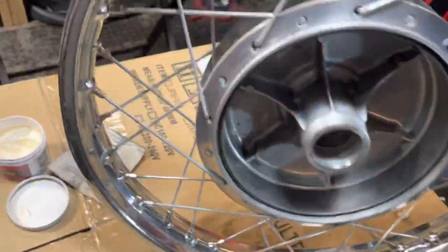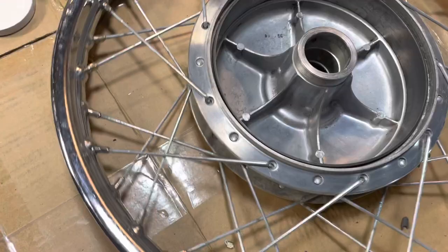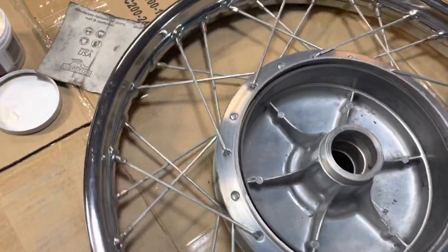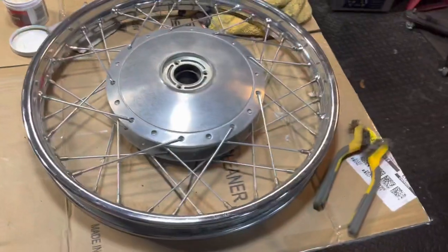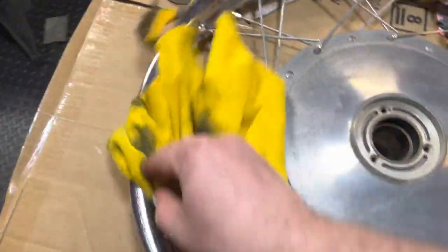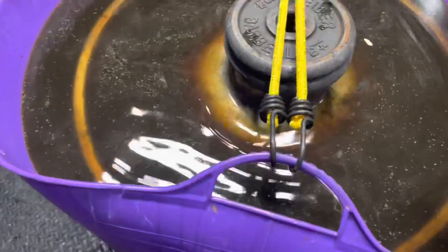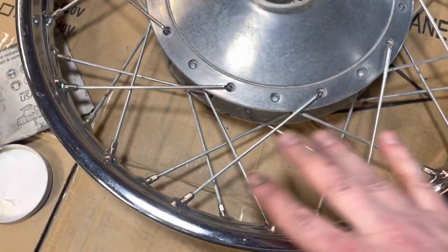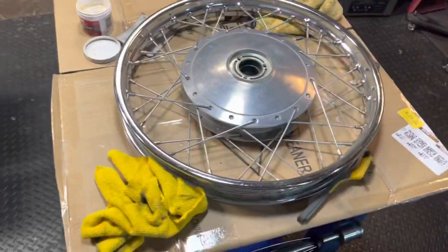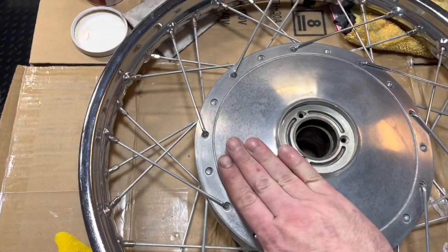Big win here, and a big money-saving opportunity — relacing isn't really a cheap endeavor unless you do it yourself, and then you've got truing and all these other things. But this wheel is in great shape, and by the time I'm done polishing it's gonna look pretty damn good — pretty minty. Red Gorilla, Evaporust, about a week: come in, agitate it, swing it around, pull it out, wipe it down, and just keep letting the Evaporust do its work. One spoke at a time.